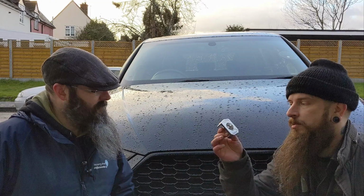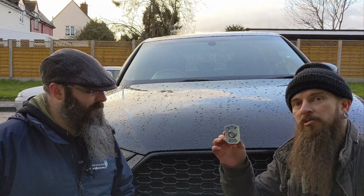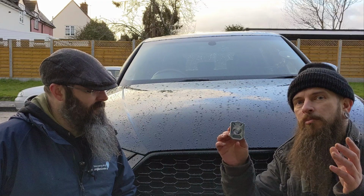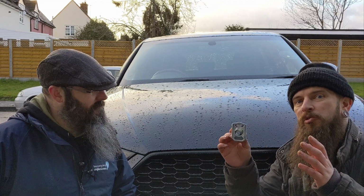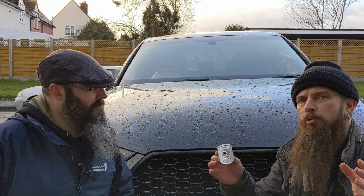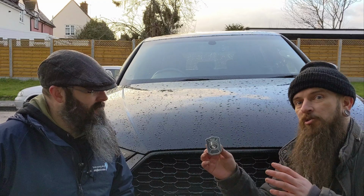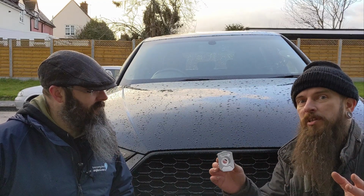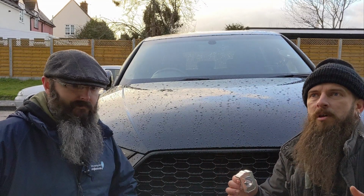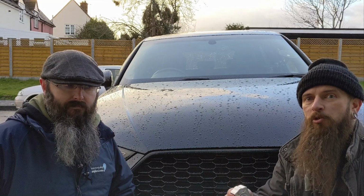Why insert that into your dog mount, you may ask? It's because it reduces the flex between your transmission and the rest of the car. So what you can get out of it is a much more brutal gear shift and less flex, which also results in less wheel hop. Not only does it improve the feel and make it feel more sporty, it can actually improve the launch.